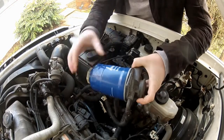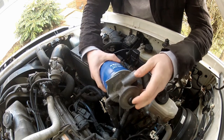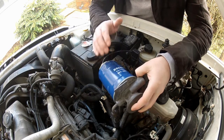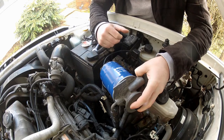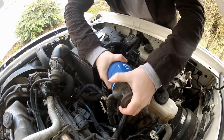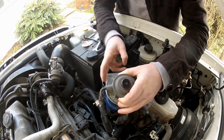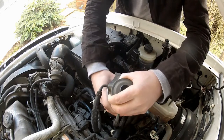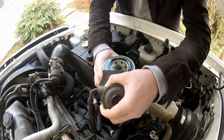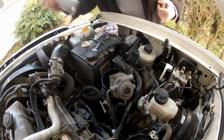After you've done that the whole assembly should just lift out of the housing. So now we have access to the old filter - this blue canister obviously. These should just twist off by hand, and I say 'should' because some people like to really crank these things on. If that's the case you might have to get creative with a filter wrench or a pair of Stilsons or something like that. I replaced this last so fingers crossed it won't be too bad. Now as you unscrew this, try and keep it as level as possible because it will be full of diesel.